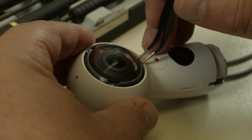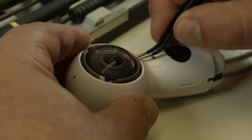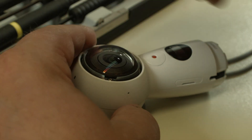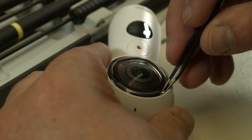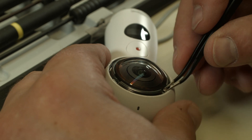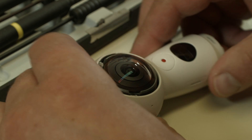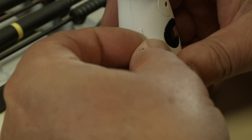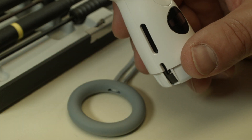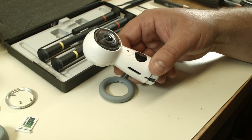It's best to grab them from the side — not from the bottom. There you go, like that. And the last one. The lens doesn't seem to be out of plastic; I think it's glass. Now you have to get the whole thing open. First you need to remove the SD card — that thing has to come out, otherwise we can't remove the upper part. Only the upper part comes off.